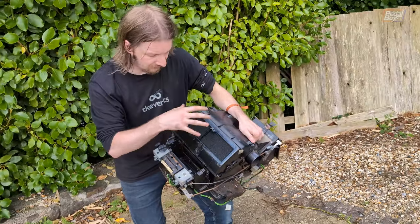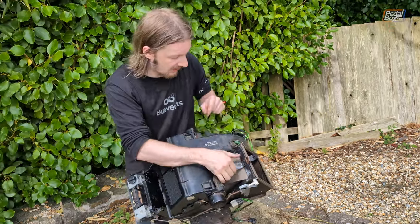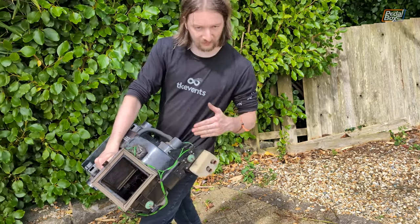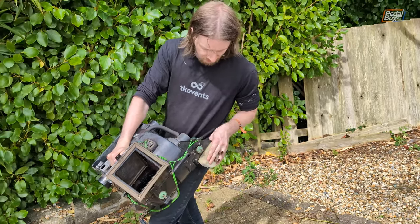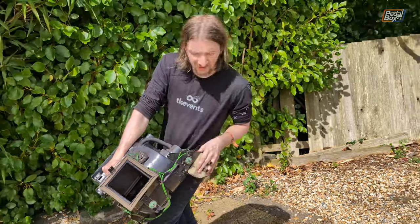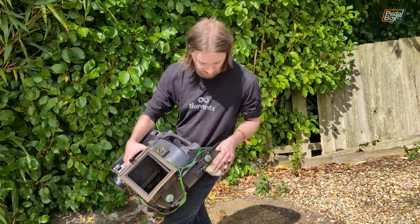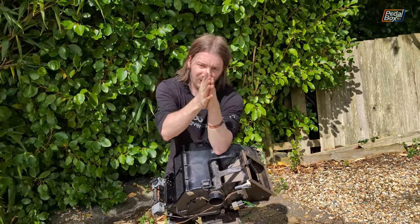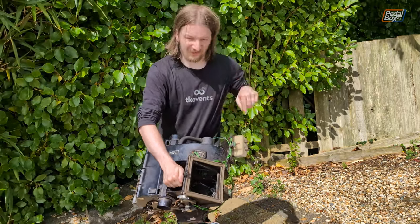Now that's been painted — because this is visible through those face vents — we've got some black paint on the foam. I think we're ready to pop this in the car and start figuring out how to seal around our water pipes, because this is where the front firewall is into the engine bay. We're going to put a piece of sound-deadening butyl rubber on each side of the firewall and hopefully sandwich the metal of the firewall and the hole between these two pieces of self-amalgamating rubber to form a really good seal and stop what happened to the original foam from happening to this piece.